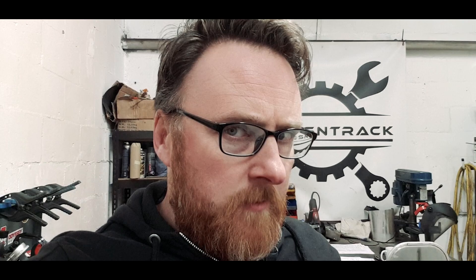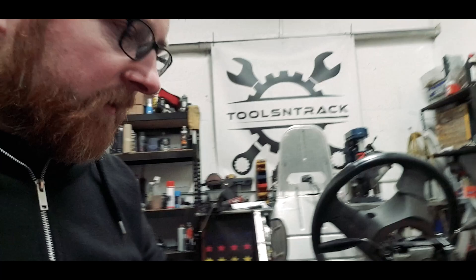I'm about to do something that might be quite rash. We're now at the big spaghetti junction. I'm trying to thin it out because there's far too much here and there's a good chunk of it I'm pretty sure I don't need. One such thing is a very obvious fuse here for audio. Audio has a red with green stripe wire coming to it that comes straight from the main fuse box - that's a power supply.